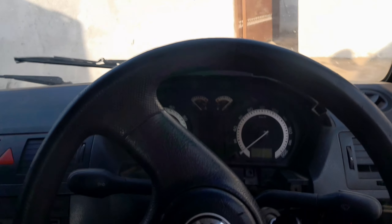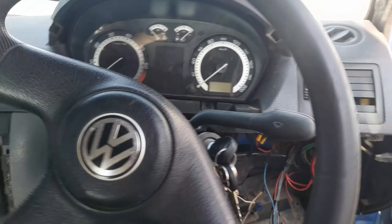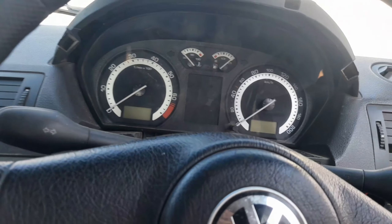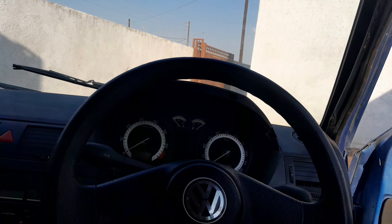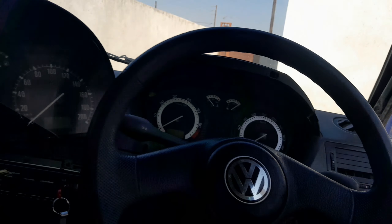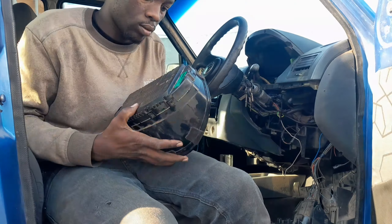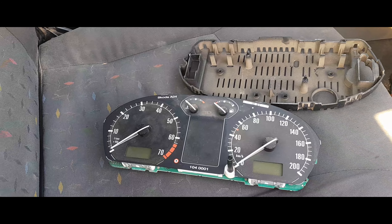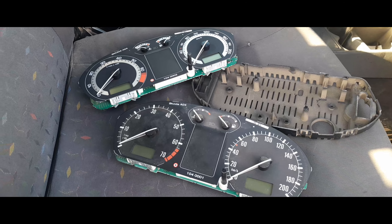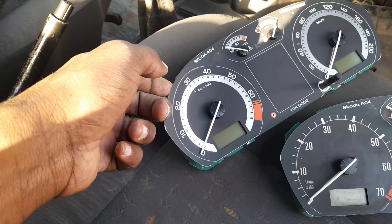We finally got the cluster in, but the cluster is not showing any clocks right now. I don't know — maybe I should put the key in so that it can show. But this is a bad sign of it not working, or it needing a control box related to it. Let me try to get the key and see if it will make any difference. Nothing. But let's see if the car will start. Yeah, the car starts but the cluster is not showing anything or saying anything, which means the cluster might not be working. Maybe we'll need to swap everything from there to this one.